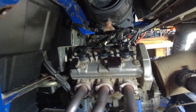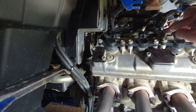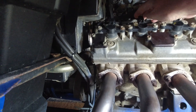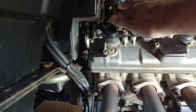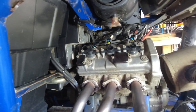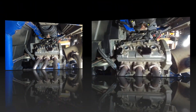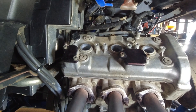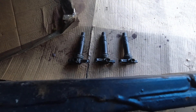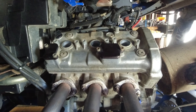First you need to remove all the electrical connections on this breather pipe. I've already unclipped the coil connectors. Next I'm going to remove the coils and then the rocker cover can come off the top of the YXZ. The first stage was to remove the six bolts that hold the coil packs in, so they've all been removed and there are the three coils in order — I'm going to keep them in order.